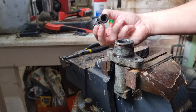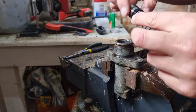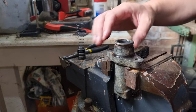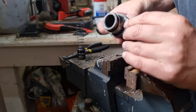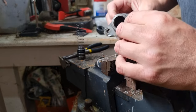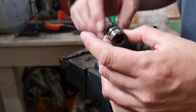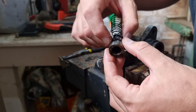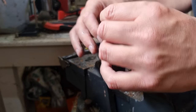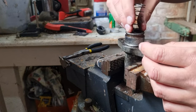I could put a new seal in this, but the top of the piston has some scoring on it — it does look a bit knackered. The front definitely looks knackered. I think there's been water in the fluid, and that has been half the problem here. There's at least one big deep score all the way up the side. If the debris I can see came out of there, there have been metal shavings stuck in this lip — I think this is actually meant to have an o-ring in it, not just the one rubber seal. This could be refurbished, but at about 40 bucks for a replacement I don't think I'm going to bother.